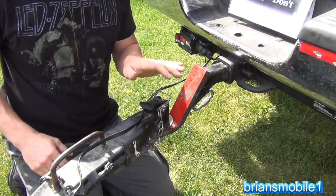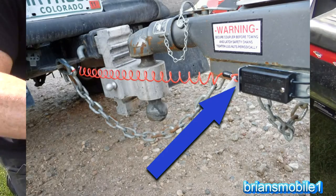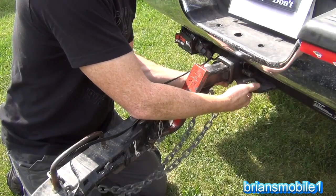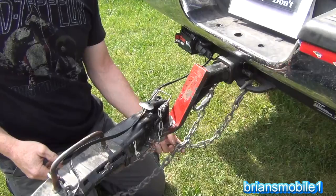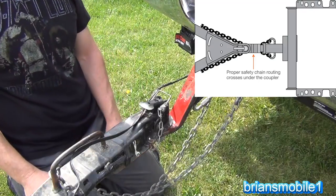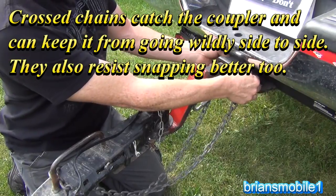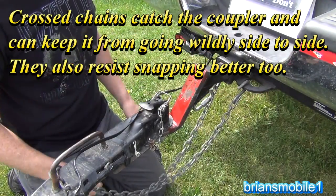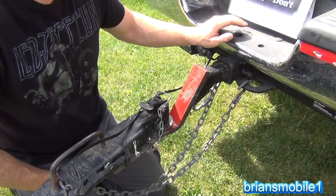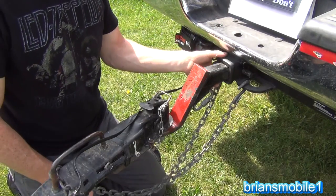The last thing I need to do on this setup is the chains, because I don't have an emergency breakaway cable, and I don't have a load distribution hitch or a sway hitch. So I cross the chains and hook them up like this so they cross underneath the coupler. This is at an angle so it looks off to the side, but going down the road that would be underneath. If it's a bumper hitch that sits on the bumper, you're not going to have to worry about the pin but you are going to have to worry about keeping your weight down — these aren't able to hold near as much weight as something like this.